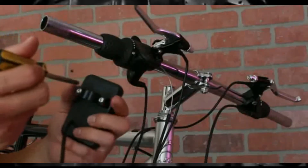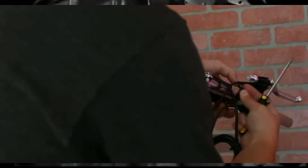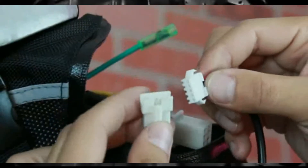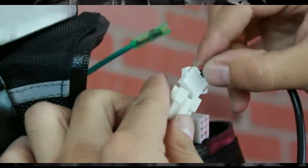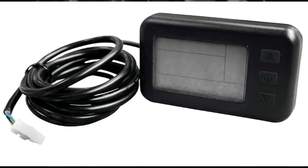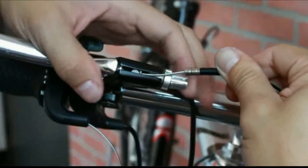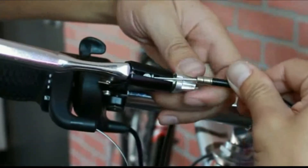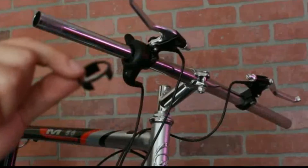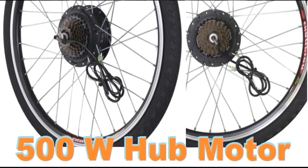Wiring and cables replaced to convert into an e-bike: attach the control cable from the wheel to the controller box. Install the sensor to the hub and plug the wire into the controller. Mount the display box and handlebar assemblies, then plug the controller to the LCD display and two handlebar motor and shifting controls. You may want to upgrade your brakes to disc brakes while doing this step; otherwise, reinstall and adjust brake lines. It's an easy conversion from bicycle to e-bike when you use a hub wheel kit.